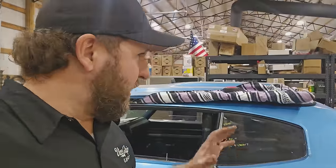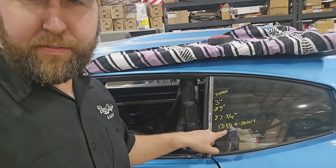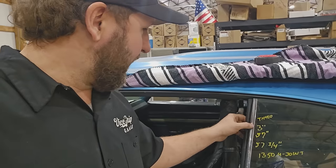the list. Okay, so Chad's finishing bolting up the drive shaft under there, and we discovered the U-joint isn't correct. And it takes a 1350 U-joint. These are all the measurements I took on that drive shaft. I got another one being built. I don't know how that's gonna work.